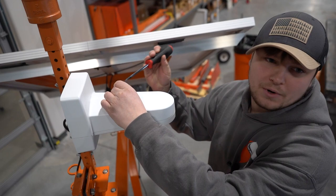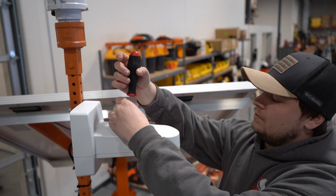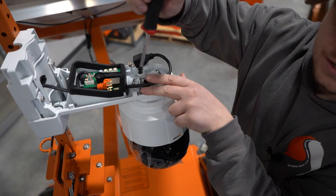The first thing we're going to do is take this rubber grommet out if there is one, and then there is a small screw hole here that you can use your T30 to remove the top lid of the camera mount. Be able to push the camera up through the mount, give it a short twist and lock it in, and then we have three screws on top to tighten down the camera.